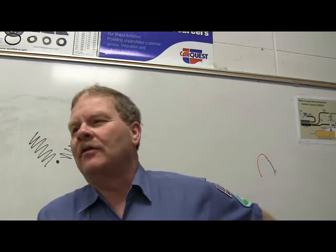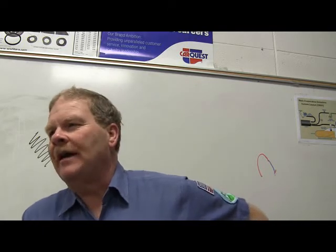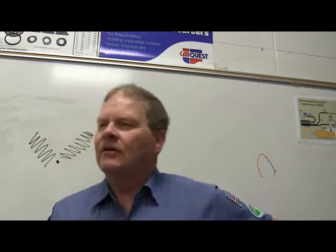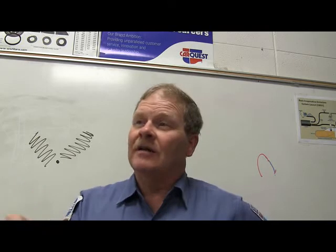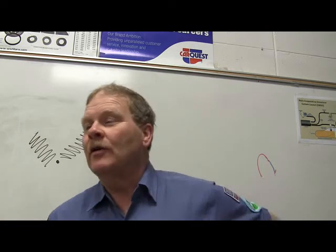How many of you have ever been in a traffic jam where you had to sit in traffic for a long time on a hot day? All right. If you got your vehicle in drive, the transmission is going to get hotter and hotter and hotter, and it could eventually start boiling the fluid and puking fluid out the vent.